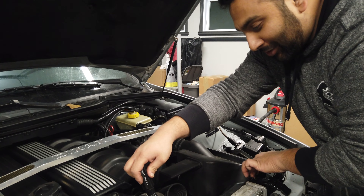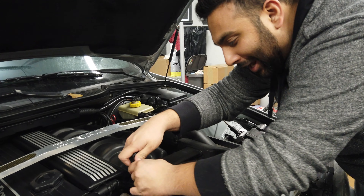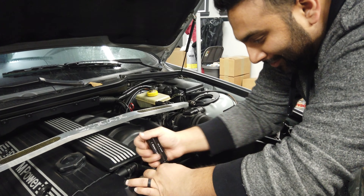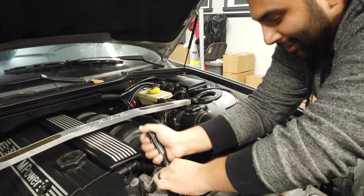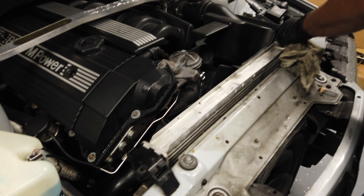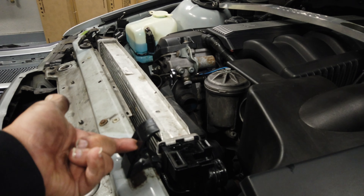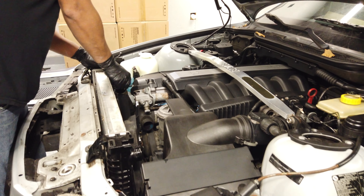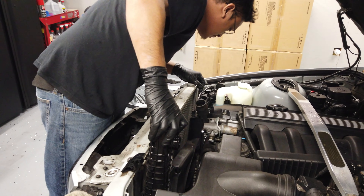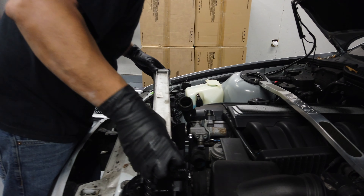Right now we're removing the two screws on the upper radiator hose so we can get more space to get the fan clutch out of the way — there's not a lot of space back here. You remove those two, pull the tube, and then you have the access you need. To remove it, it's a double-lock system: you stick a screwdriver in, push it forward, then pull it back — and then the radiator should just pop right out because we've disconnected everything.